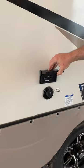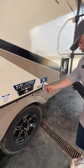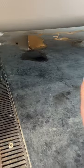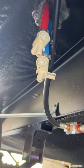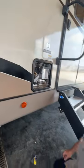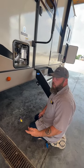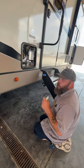Next, we've got a 110 hookup outside here, and then you can hook a TV up outside. They also give you a dog leash hookup. Your low-point drains are located underneath here — they are red and blue, tucked up underneath there. You've got red for hot and blue for cold. I always like to recommend you open those guys up, open up a faucet inside, and as you go home, the air is going to blow through those lines and push any excess water out so you wouldn't have water left in there that can become stagnant. Those lines are also used when you go to winterize your coach.